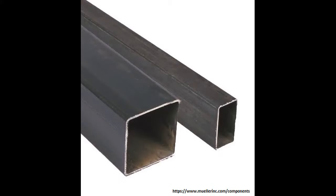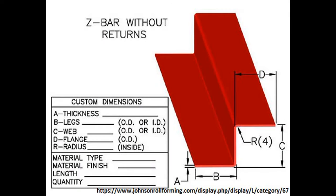The next thing I would be considering is I would want my trailer to be made out of box tubing and not the Z-channel. The Z-channel is functional, but it's not as strong as the box tubing. Unfortunately, the only way to be sure you have a trailer made of box tubing is to take the interior wall off to see it.